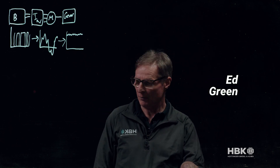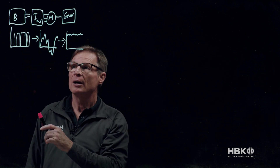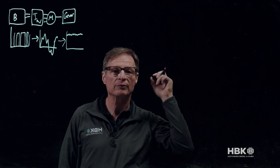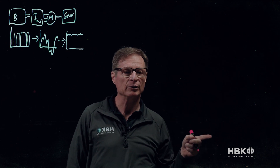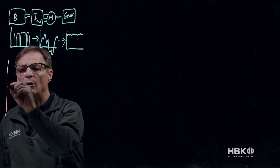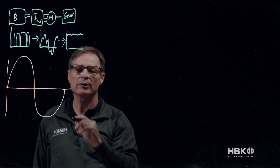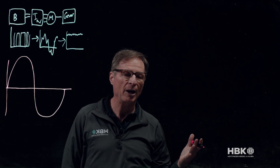My name is Ed Green and I'm going to get a little bit more into the noise and vibration details. Mitch outlined our battery, inverter, motor, gear setup. Batteries don't make noise, thankfully, but batteries in a modern electric vehicle almost always have a pump or a fan in them, so those are all part of the NVH solution. What we would like the inverter to do is to produce a perfect sine wave — that would produce the least amount of noise and the least amount of torque ripple, by providing the smoothest possible input.